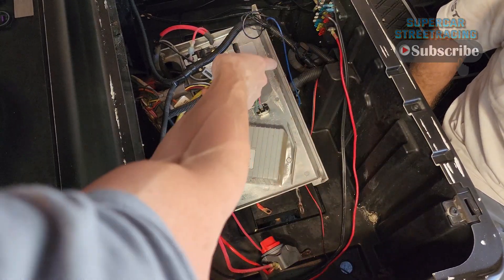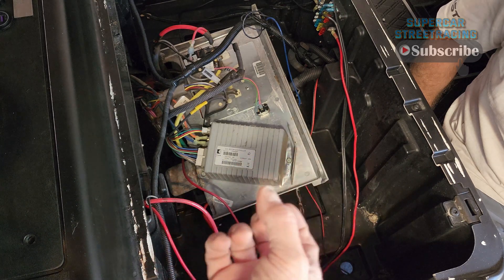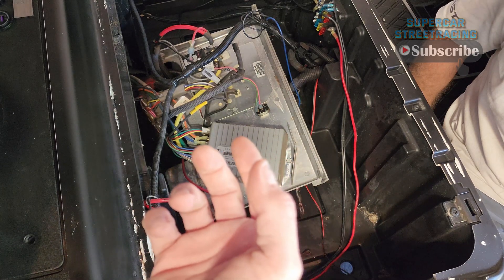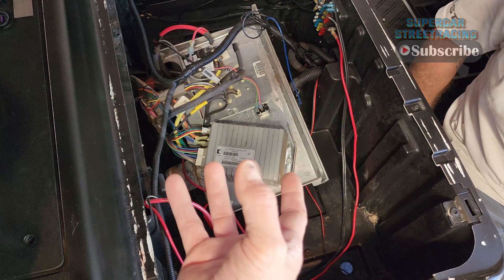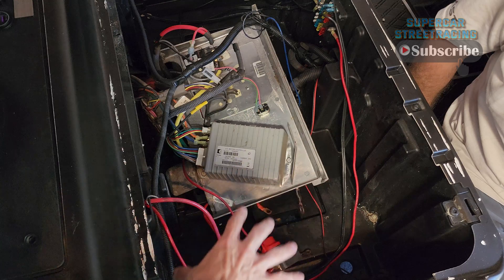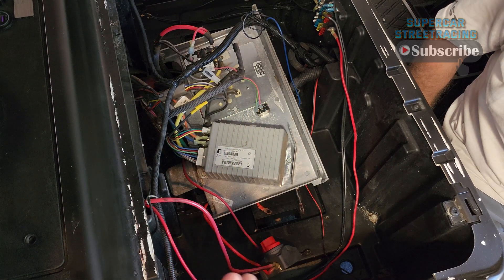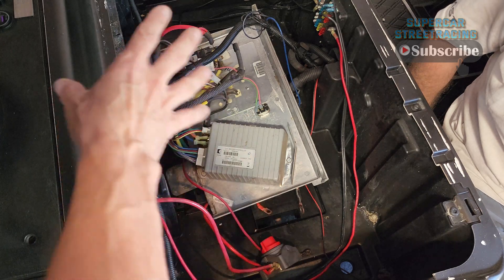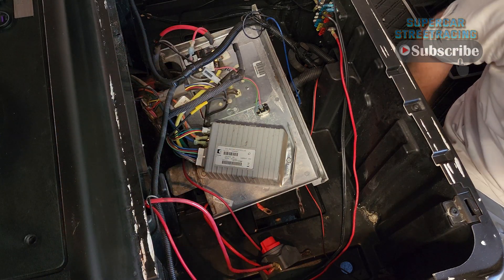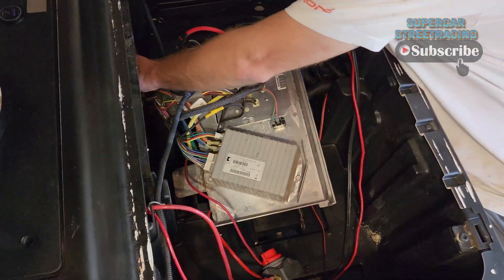The entire charge port and charge port housing will come out, so we'll have to remove these hex bolts here. This whole panel will loosen up, we'll pull that charge port out, and there'll be a male plug for a standard extension cord. You plug your extension cord right into it and you have an onboard charger that sits here. This bay will be mostly empty and we'll shed a couple hundred pounds. We'll be able to do whatever we want with the bay. So what do you say we get the controller out of here?